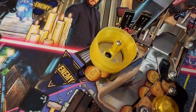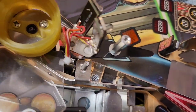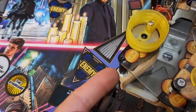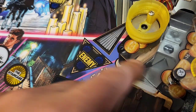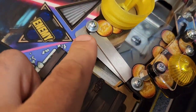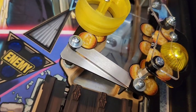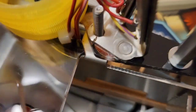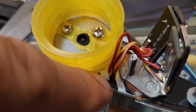Next, get this plastic back in place — don't put the coin on yet. The hole behind the spotlights goes on top of this stud right here. Watch your wires and that should allow the plastic to sit back in place. Then come back to the front — that metal triangular plate should protrude on this side. Slide it underneath this plastic and put these two screws back in. Note: each of these screws had a screw, a lock washer, and a washer, so make sure you don't lose any hardware. Also note the back side of this plastic has a slot — that's to allow these wires to have a place to go, so as you set the plastic back in place, make sure the wires go into that slot.